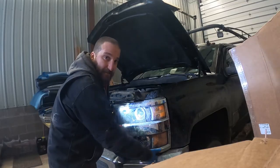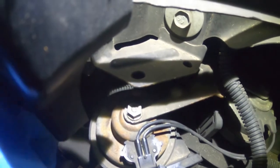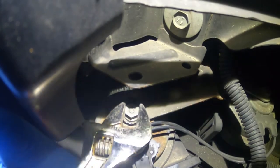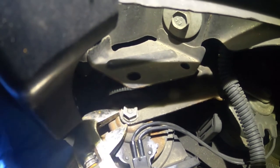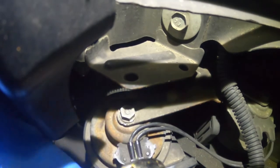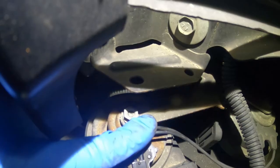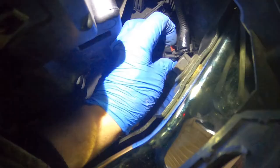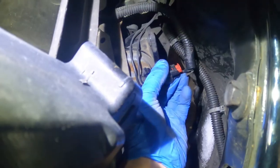There is a weather seal on the bottom, so it's resting on the bumper and you're not going to scratch anything. Now I've got to get the bolt off the top of the horn. I'm getting my crescent wrench in here to loosen it — there's not enough room so I have to turn it around. There's just enough room for about a half turn, then it's loose enough to do by hand. Now there's a little red tab on the connector that we have to pull up. I couldn't do it with my finger, so I had to use a flathead screwdriver to pry it up.